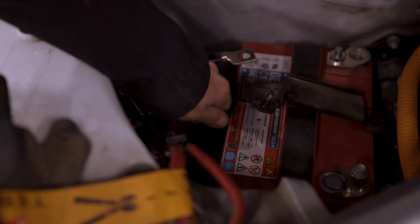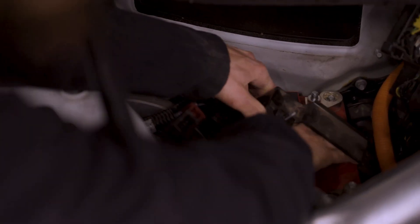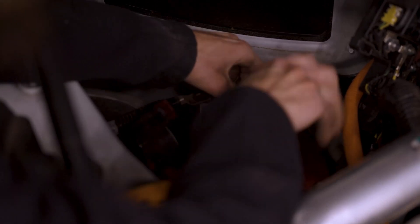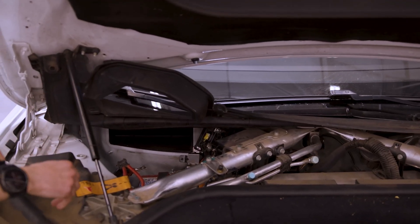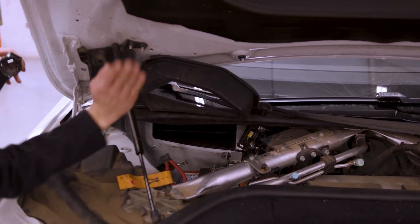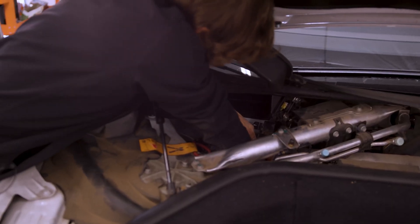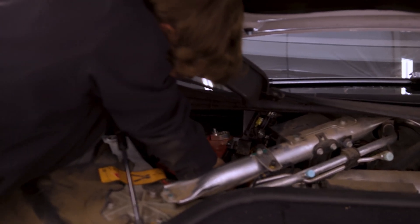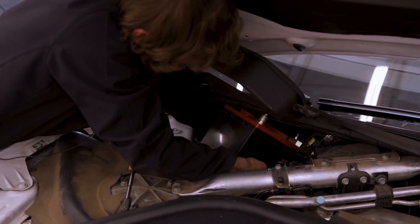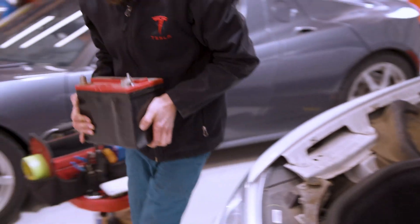The clamp is up on one side and the tape is holding the hook in place. Move the clamp out of the way, then pull the battery upwards and tilt it at the angle of the exit, then straight out. Get a hand under the battery, get the main section up, and tilt it upwards a little bit — and we've got it.